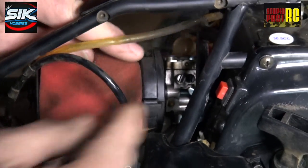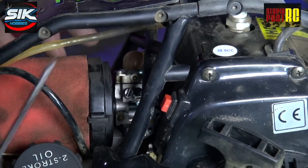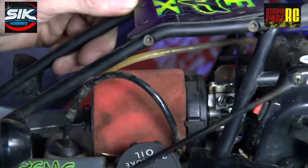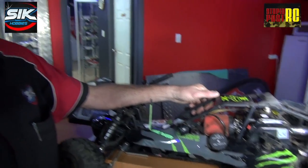Always oil your inner sock on your air filter. That stops you from dusting out a motor, or sucking dust through your carby and hurting the inner piston. That's about all you can tune on them.